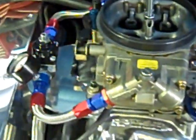And then I put that coil on there, it's a road racing coil, so it stays a little cooler. It's got more heat sink in it, and then the MSD box there. So that would be the best way to set them up: 24 initial, put the starter saver on there, and you don't have any problem starting it. So I'm running 38 degrees total with the 14 in the distributor and 24 in initial, and I don't have any problem. It runs great. Put it in gear, it runs fine. Doesn't overheat, starts right up, and it runs really good. It's got plenty of power in it.